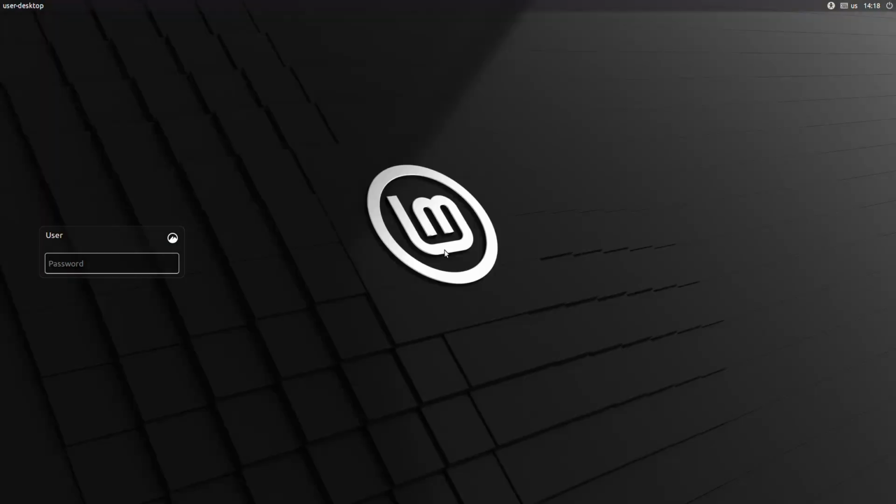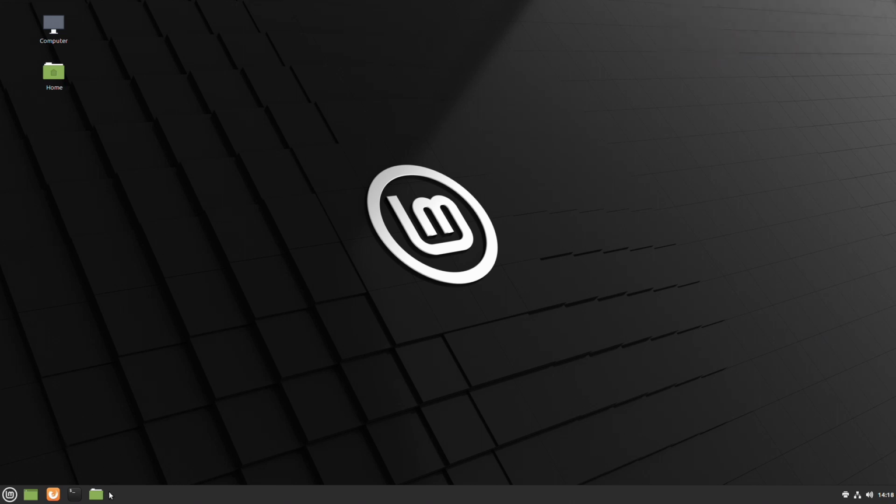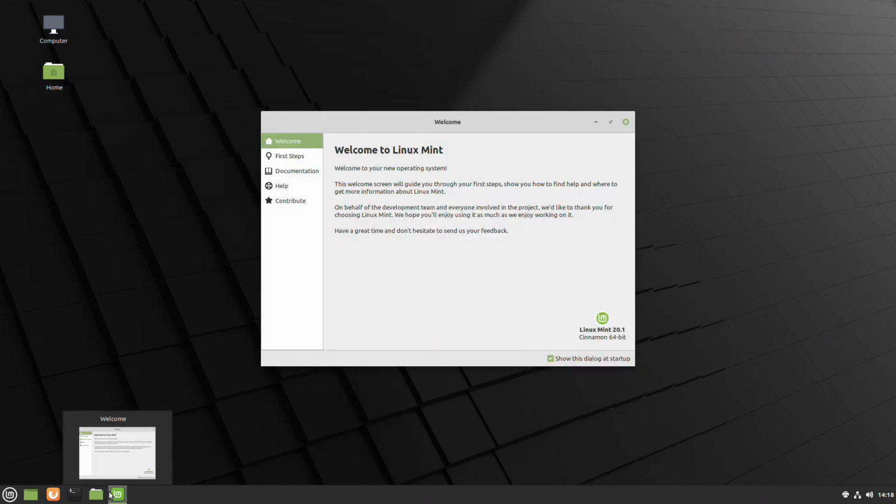Again, the reason we do that is because if you're doing updates in Windows and the machine reboots itself, if it's set to Linux Mint by default, you get the first stage of the update is done, but you could come back to the machine an hour later and it's sitting there in Linux Mint and the other part hasn't finished. So you want to make sure that it defaults to that, just for the sake of argument. And of course, since this is running off of a mechanical hard drive, it will be slower. There's really no way around that. Again, if your terabyte drive is a SATA 3 drive or another NVMe drive, then obviously it'll be a lot faster than this.